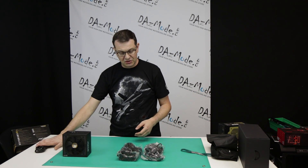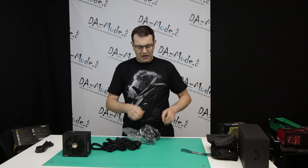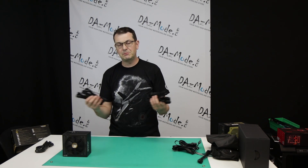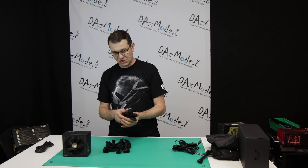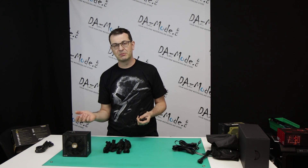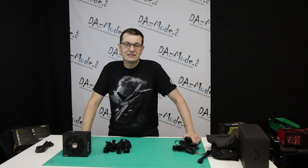So let's look at the cables. The power cables are standard — nothing special. We have two sets of other cables, one of which is sleeved. Traditionally the sleeved ones are your motherboard, GPU, and CPU power cables. It's not perfectly custom-type cables with everything in one major sleeve. If you're building a system where you're going to use extensions, it's the absolutely perfect scenario — you have black unobtrusive cables going from the power supply behind the motherboard area, and then you meet them with your extension of a custom color combination that you show on the front. That's how I do 99% of my builds.